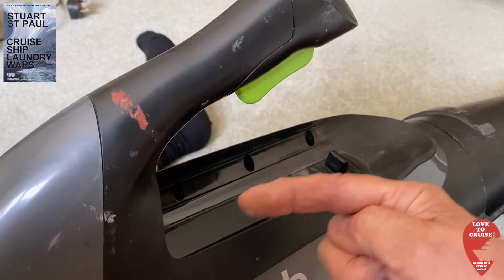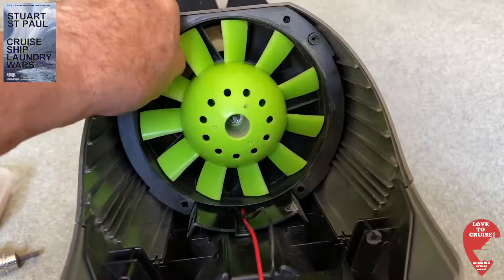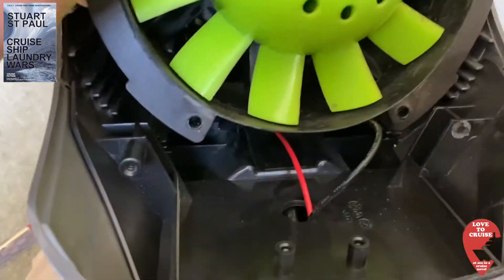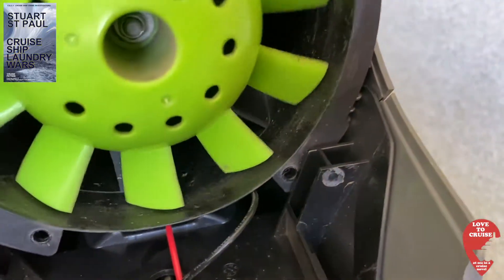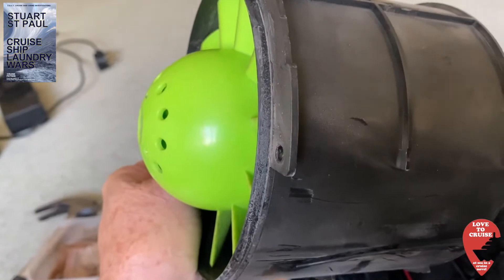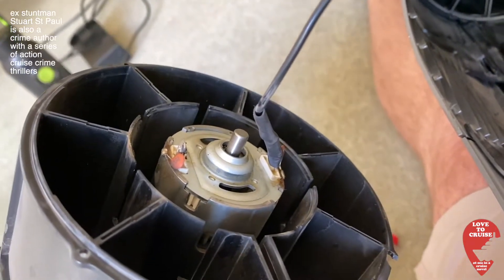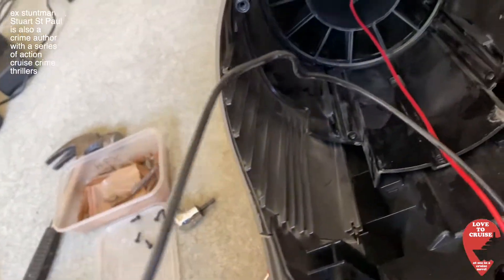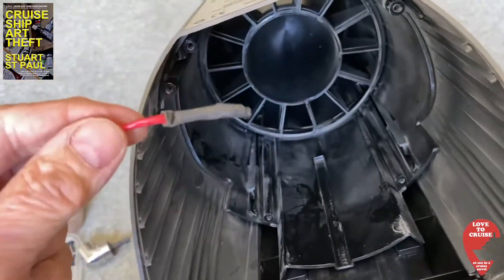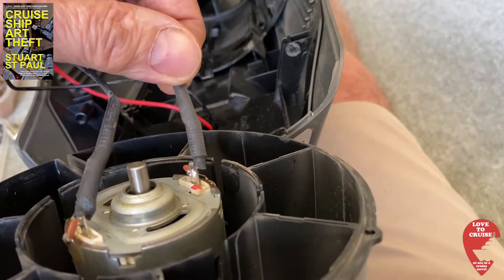Remove the inner skirt, which comes out very easily, and we hope the motor hasn't gone wrong. Ease the handle assembly away with a little nudge, but be careful there are wires to the motor. Now remove the motor — four screws, one in each corner — then just pull it free. Now we discover what's broken: a cable has come off the motor, probably due to vibration or the torque as the motor starts to twist and stops.